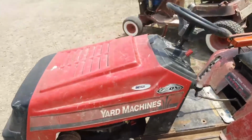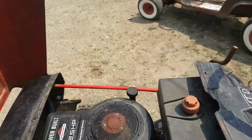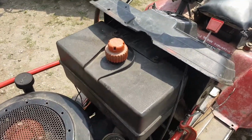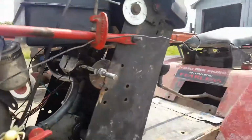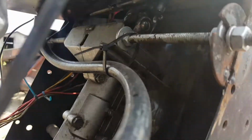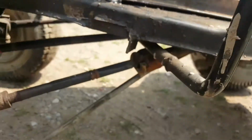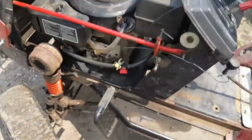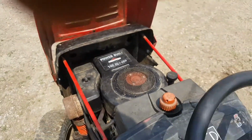And under the hood, again, the engine isn't really any different. I got the different fuel tank in there. The reason for that, of course, is the new steering box you guys saw in the video where I took it apart on my workbench. I got it in there and it works really, really good. It's kind of hard to see my fuel lines with the fuel tank there. You see the U-joint up in there. The drag link comes down, hooks to my steering arm right there. It's really nice. It's got a real nice ratio.